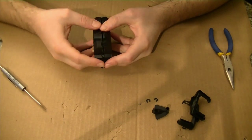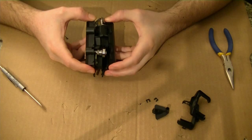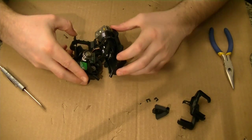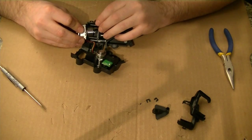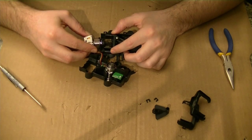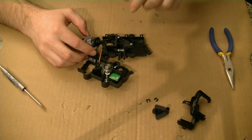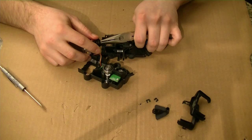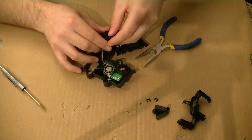Once you've pried the clips off, take the extruder and pull it apart gently — you don't want the pieces falling out. You're going to want to take this nozzle and pull it out from here. Be very gentle. You can see right here this is the filament that's jammed inside the extruder. Take your needle nose pliers and just pull out the filament. You can also take this off, which might make it easier.